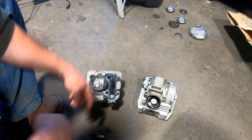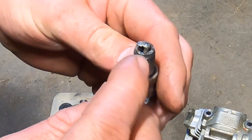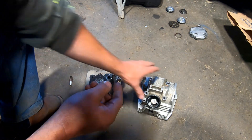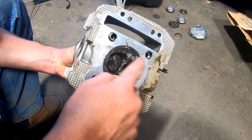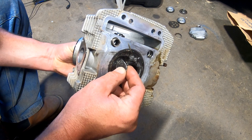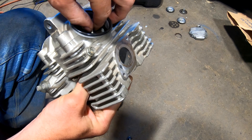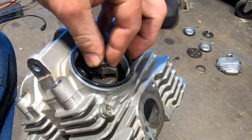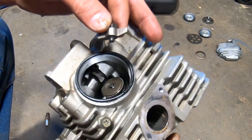The damage on all these parts is just incredible. The first thing I did was take out the spark plug, and you can see how it just hammered the end of that spark plug in on itself. The head of this exhaust valve fell out of the head — it broke off from the stem; part of the stem is still in there, and a little piece of the stem was in the header. Part of it passed through, but the head fell into the cylinder and must have hit the intake valve when it was trying to open — because it actually broke the rocker arm. The cam was spinning around, the rocker arm was trying to push the intake valve down, but in between the piston and that valve was the head of that exhaust valve, so it just broke that right off.